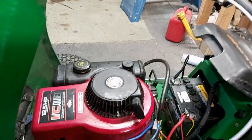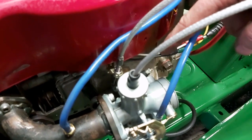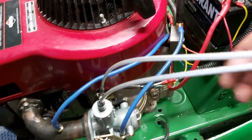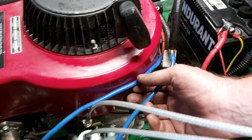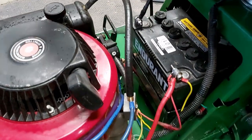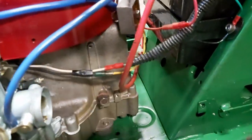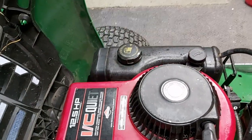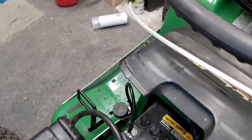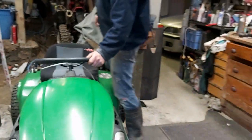The new accelerator cable turned up over the week. It has twin parts — one for the accelerator pump and one for the carburetor itself. We've also sorted the wiring and hoses: this bit here is running the vacuum pump and we have a return line coming back into the tank. When it's running you can actually see the fuel squirting back, which keeps the fuel cooler and stops it from over-pressurizing the fuel system. We had a little touch-up with paint in there and it's all looking pretty good. The big question now is — does it actually run?